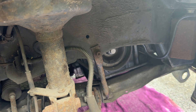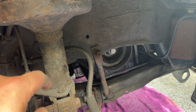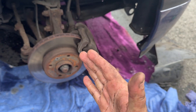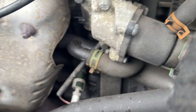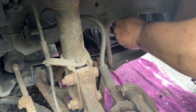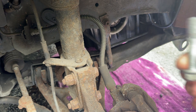Next we're going to remove the crankshaft pulley bolt. If you don't have an impact wrench, you can try to lock it off via the starter, or put it in fifth gear and drop the car back down onto the wheel. Turn the wheels to give you access. On some of these cars there's a little blanking plug to lock the crank off, but on this one — and many other 1.4s I've seen — there isn't, so don't worry about that.